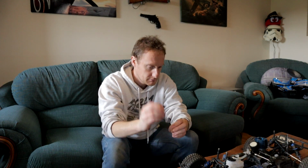Okay, that's finally 2 tanks of 50% throttle, approximately, done. I think we're getting there now. I did struggle really badly today with it stalling quite regularly, and then it wouldn't start, it wouldn't start. I had to use some throttle to make it start. And then it would start, but it would obviously try and take off, and it's not good for the clutch. It would stall whenever the pull string was released.